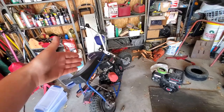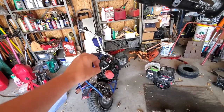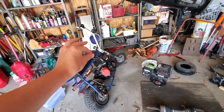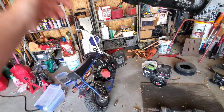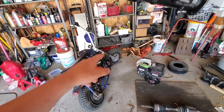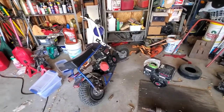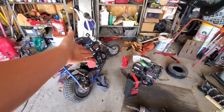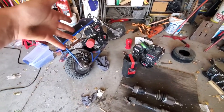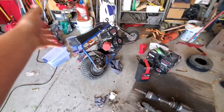I'm going to check the governor — I don't think I've ever actually adjusted the governor on this one, and I probably won't adjust it until I get some more data. I might hook up a spark plug, get an RPM gauge on it, and then test things. But first I'm gonna take the side cover off and check the magneto.